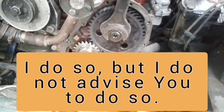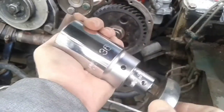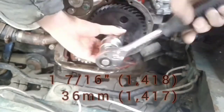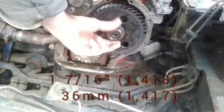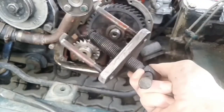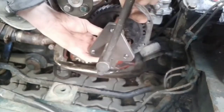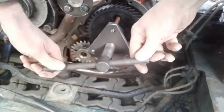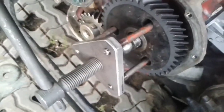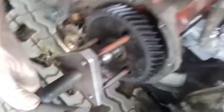It's time to take out the gears. Loosen the nut carefully. I don't remember where my set of large-inch sockets is, so I use a 36 mm socket. A puller is definitely needed — no question. This special tool can be used for removing the original fiber gear from the camshaft of Volvo engines B16, B18, and of course the B20.